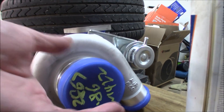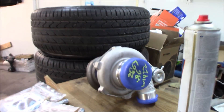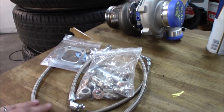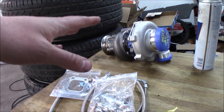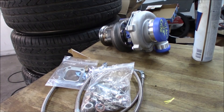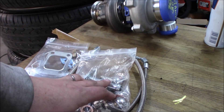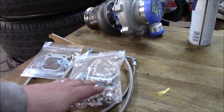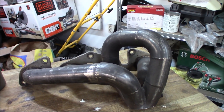This is a ball bearing turbo with internal wastegate and it should be able to produce something like 550 horsepower under the right conditions. We also got some steel braided lines, which will be interesting because the exhaust manifold we're fitting is going to move the turbo a bit. I think these lines are fitted for the turbo on the original exhaust, so we'll see how it matches up. Another challenge will be the oil return pipe - I'll use some type of hose since it's not pressurized, it just needs to flow into the oil pan.